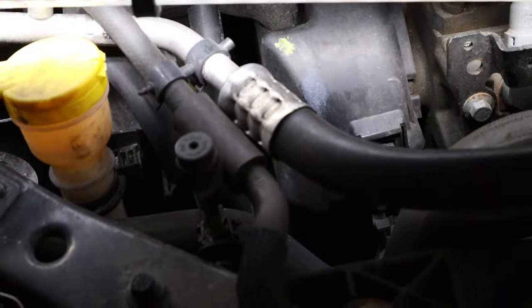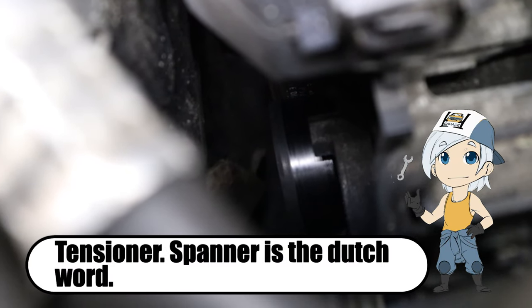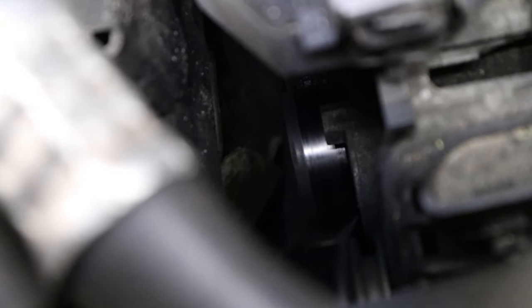Let's see how hard it is. This will be a video that I probably cannot show you exactly what I'm doing. But over here we have the front of the engine, and there we have the timing belt area — the belt itself and of course the tensioner. As you can see there's a little bit of a hexagon on there and you can put a wrench on it. Then you can put stress on it and remove the belt itself. So that's the first thing we're going to do.